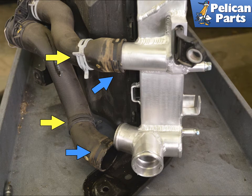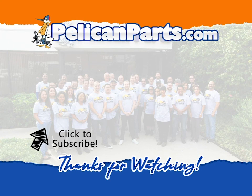Install the factory hoses after you replace as needed with factory spring clamps. Installation is the reverse of removal. Make sure to lightly coat all O-rings and hose connections with a little Porsche coolant gasket lubricant. You must vacuum bleed the coolant system — if the system does not hold vacuum, then you have a leak. Torque the hose holder to bracket, cross brace to body, and control unit to body to 10 Nm or 7.5 ft-lbs. Torque the radiator bracket to body to 23 Nm or 17 ft-lbs.